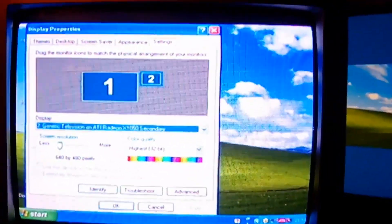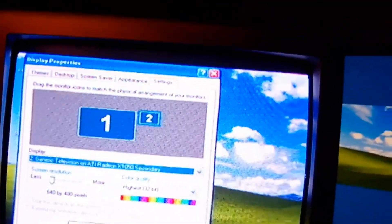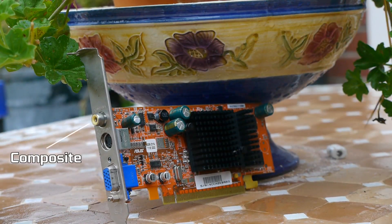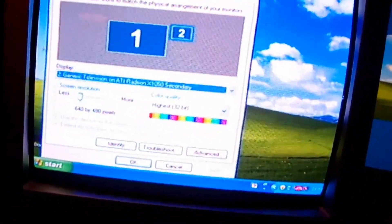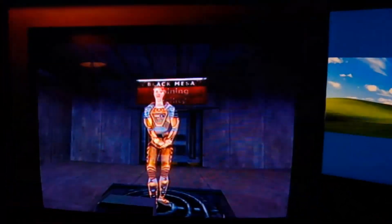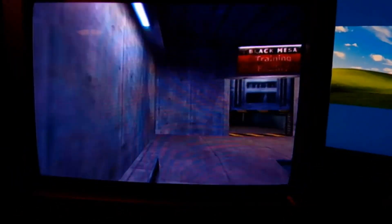Originally just over a year ago, when this video was a work in progress called 'The X300: The Composite King' — and why was it called that? Well, the card does have native composite output, which is incredibly useful for your retro gaming needs. Using the CRT Emudriver on an OS like XP, 7 or Vista makes controlling and outputting to a CRT much easier, allowing for 240p or 480i over composite with near-instantaneous latency.